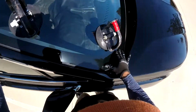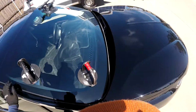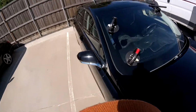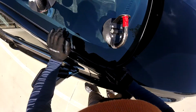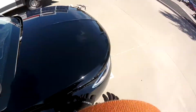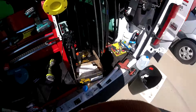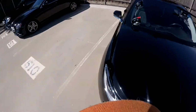Yeah, they put more urethane in those moldings, that's why I have a problem ruining my bead a little bit. Okay, the bead number is cool. So we are not too close here. Before pushing down, make sure, because this one sometimes has a problem. The aftermarket molding, like this one, sometimes goes inside or is too tight, and when you're pushing down, you risk breaking it. So before you push down, just make sure the molding is free.